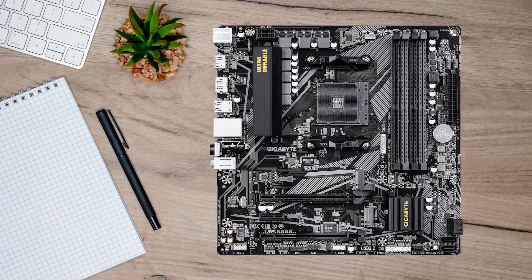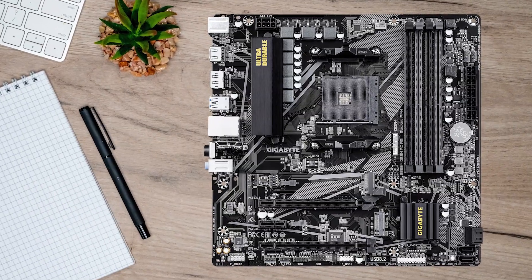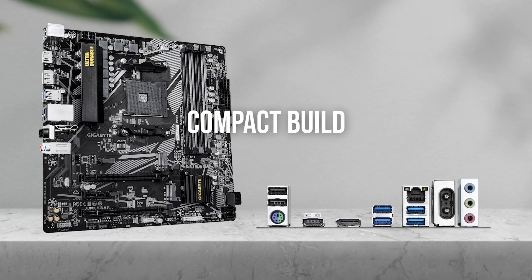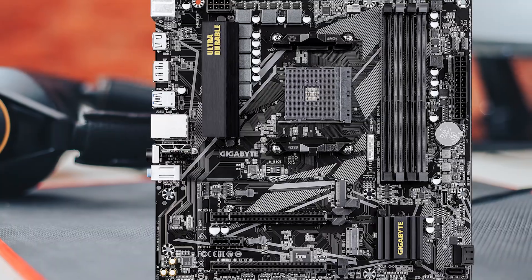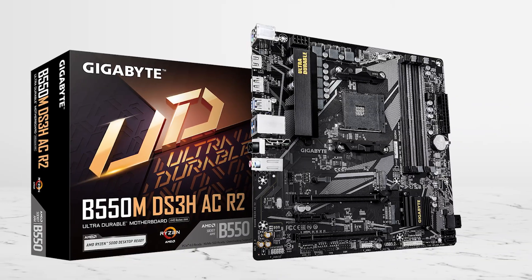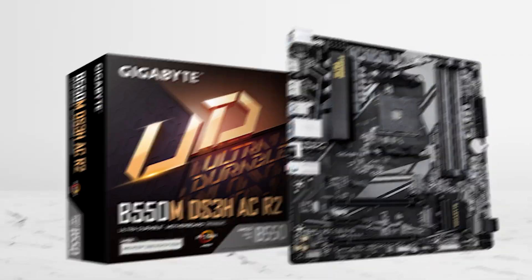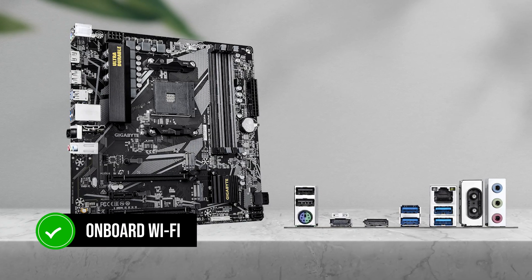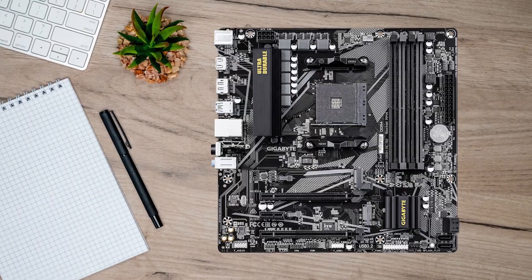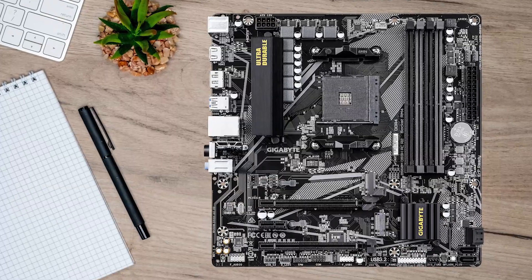Third, if you're building in a smaller case, Micro ATX usually gives you the best budget flexibility. You avoid the mini-ITX price jump but still get a compact build that fits a lot of popular cases. If you're trying to keep cost as low as possible while staying on B550, the Gigabyte B550M DS3H AC R2 is one of the cheapest ways to do that while still having onboard WiFi. Just go in with the right expectations — it's a get-the-build-running board, not a premium IO monster.